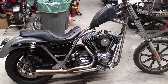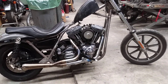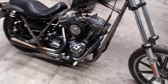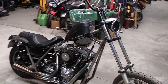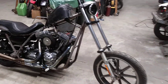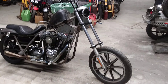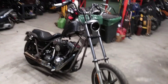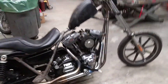Mounted the side covers and the fuse panels, fully mounted the drivetrain, welded in that front motor mount, and tacked up an exhaust system. I still got to make a top motor mount, brackets for the tank, and a couple other things, and then I'll take it all apart. Next video I make for this bike it should be all done as far as all the mock-up and whatnot, and then I'll take it apart.